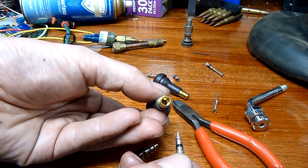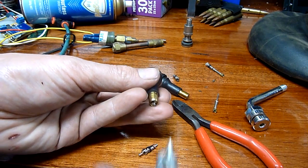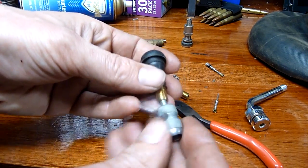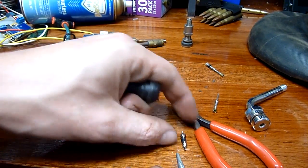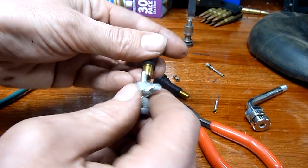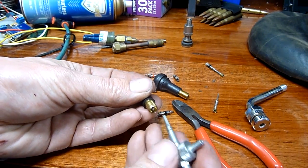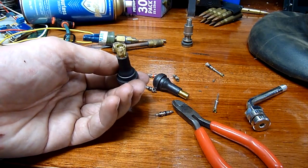To install: inside there are threads and a seat. Once it screws down inside — if the seat's loose right now, it's still going to keep leaking past the plastic seal, so you've got to screw it down tight. Once this plastic seal — this black bit — is fully engaged with the brass body, that is a mechanical seal. Screw it down tight and it's not going to leak unless it's scored, damaged, or cracked. When you connect the air chuck, it depresses the pin and creates a seal around the outside. Push air in, take the chuck off, and the valve checks the flow.